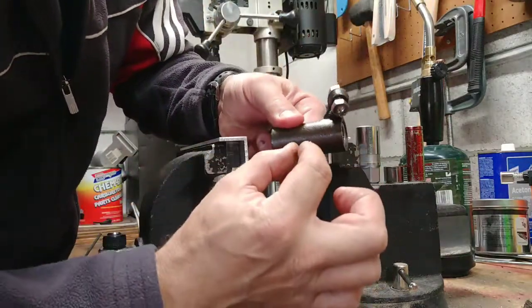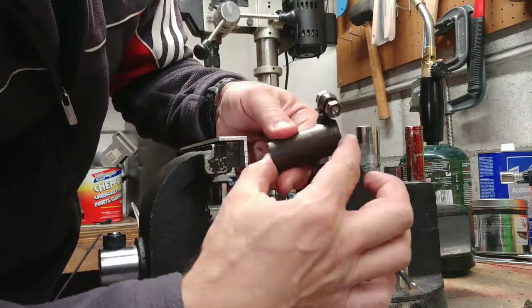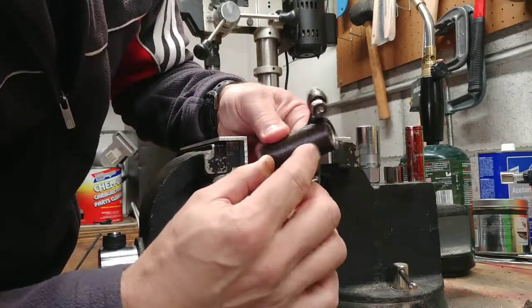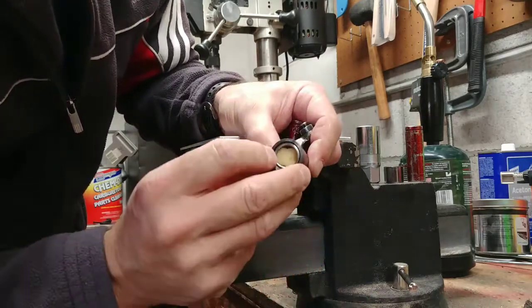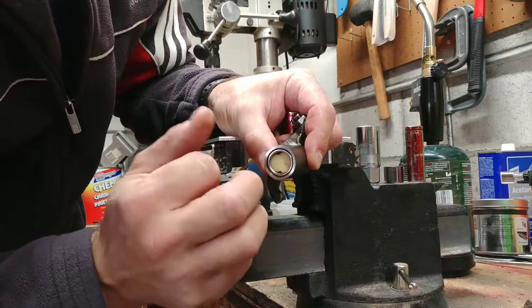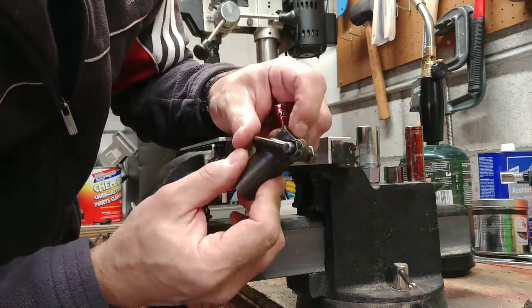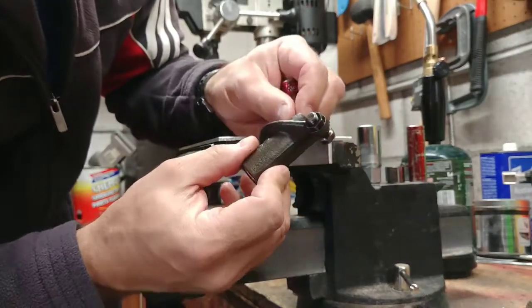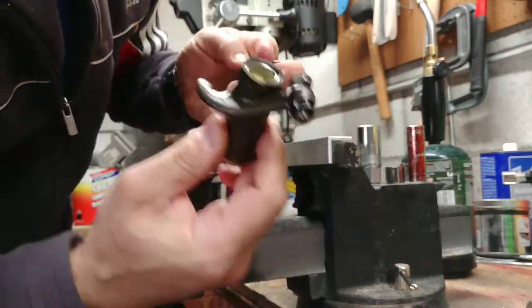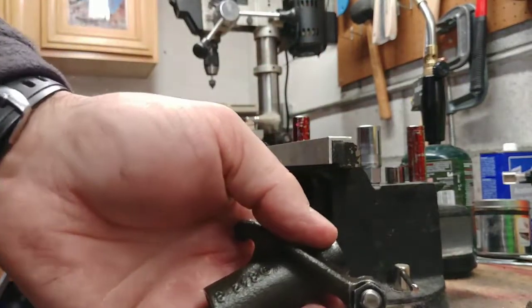So the more distance you have between those two bearings, the more stable they are against this tipping motion. So yeah, it's just a little edge here and a little edge here, and it's really not rocket science. So it doesn't really make a huge difference. This is probably a little further in than this here, but I'm not going to push that out. I'm not going to worry about it. This is just fine. Now I'm going to pause you.